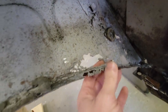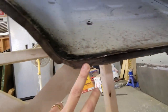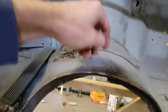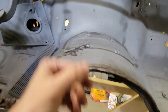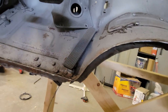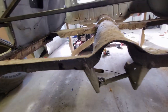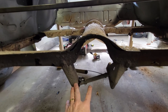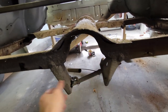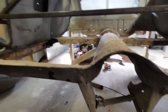You can see some more in the toe board. I've got to work my way around and split this flange - it's doubled, and there are two welded together. I've got to get the sealant out of it and get this pulled apart. Also, somebody asked about the floor pan - when we get to it, the floor pan did not come with any of the parking brake attachments. All these have to be salvaged from your car. There are probably a few more things like that, and I'll end up pointing those out as we go along.